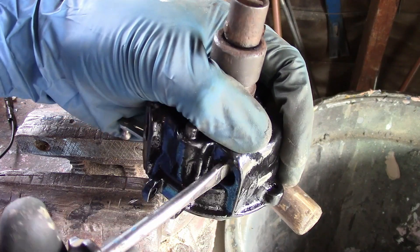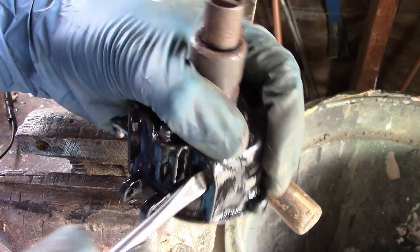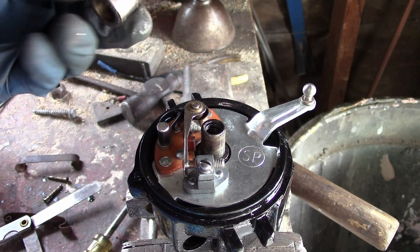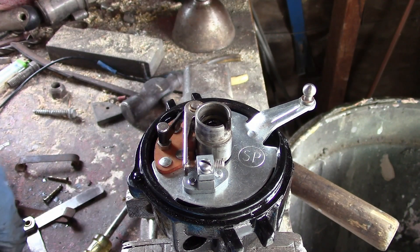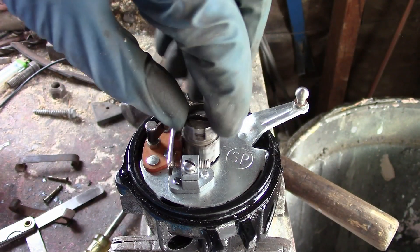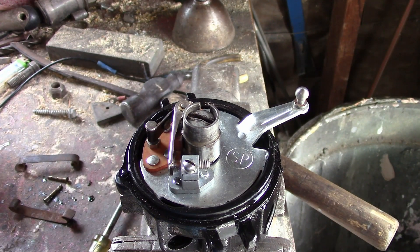I think I got it caught now. And now I'll install the cam and set the point gap. This cam is the one I took off of this distributor — I figured that would be better than mismatching it, if it even matters. I just threw it on randomly; I'll worry about timing it later. The gap is supposed to be 18 to 22 thousandths. If it's not, I'll post it here somewhere.